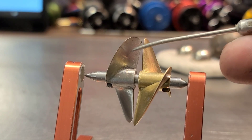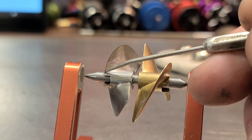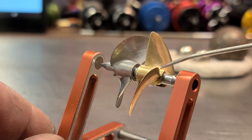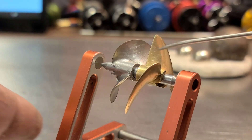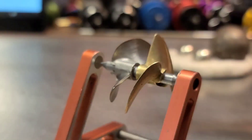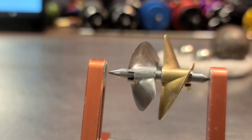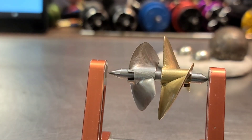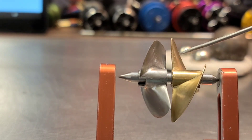In our first video, we actually took the tongue off of this propeller. The tongue looks similar to this TFL prop — it had a big tongue on it and we reduced the size of the tongue. When you do that, it creates lift, kind of lifts the boat up. It also puts less load on your motor and is supposed to help with torque roll. The outcome was we had too much lift.